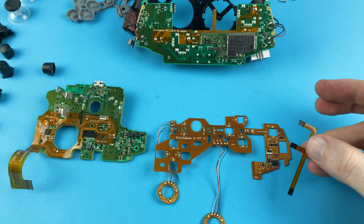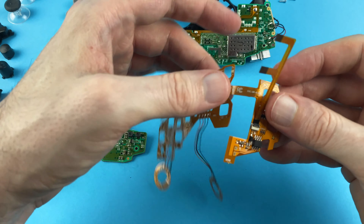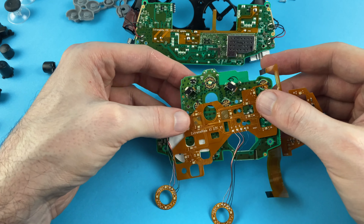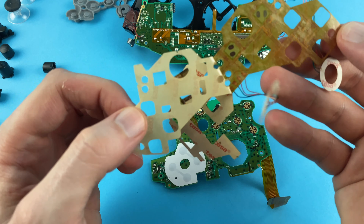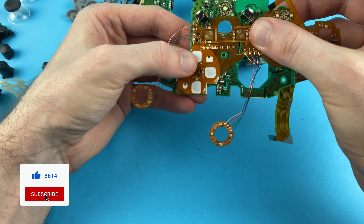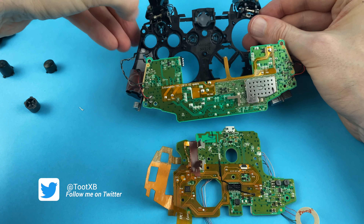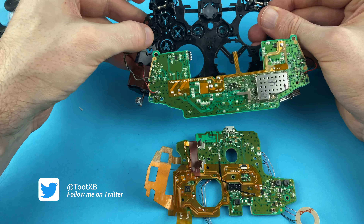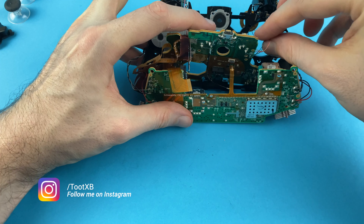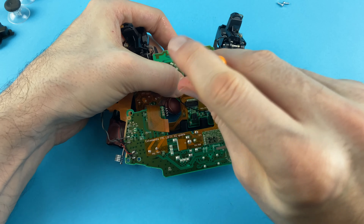First we take the little F-shaped ribbon cable and connect it into the tiny connection on the main ribbon circuit board. We then peel the back off of this circuit board and attach it to the main circuit board as shown on screen — this is a tricky bit, so be very careful. Once you peel off the backing and stick it down it's stuck there, so make sure you get it right. Once that's in place, put all of the new buttons back into the front of the controller — they can only go into each slot one way so you shouldn't have too much trouble. We then reinstall the main circuit board, threading the extra free-running cables through the thumbstick holes first, then putting all of the screws back in.